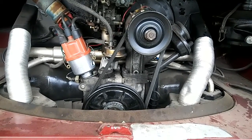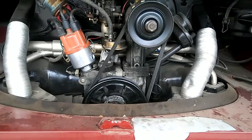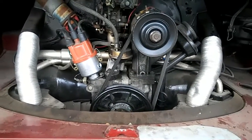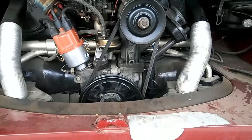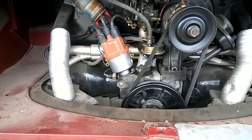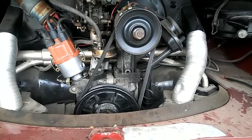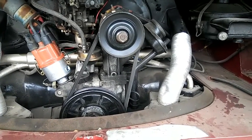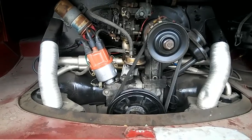Especially on an airplane — why would they put it on an airplane if it doesn't work? This is aircraft-quality stuff. Some guys will say it doesn't work, but they just don't know anything about cylinder head temperature. You can also get a cylinder head temperature gauge to know what you're dealing with. When that gauge gets to a certain point, you better pull over and let the engine cool. If you're dealing with extreme temperatures, definitely start with cool tin.